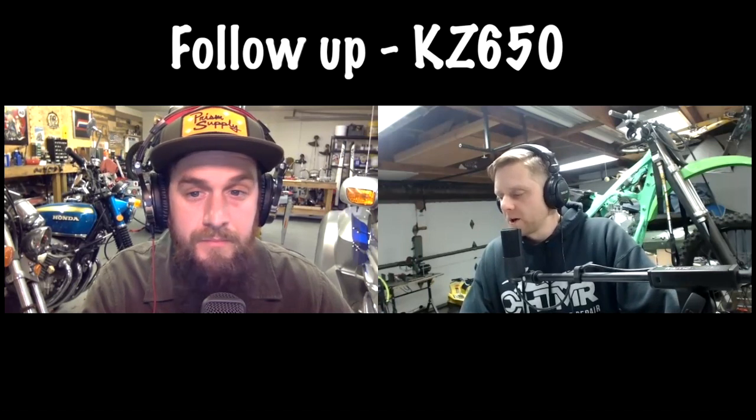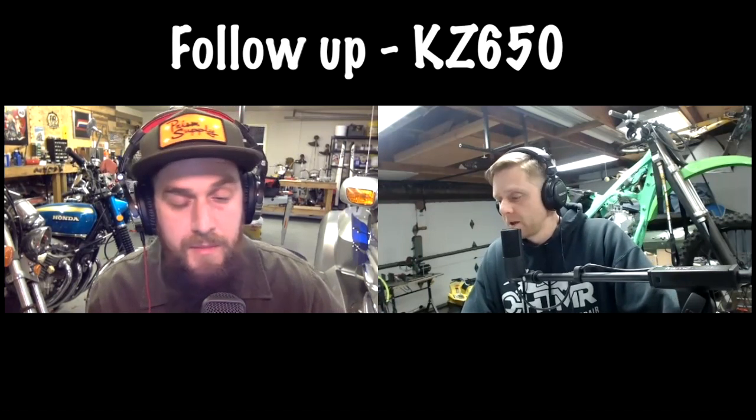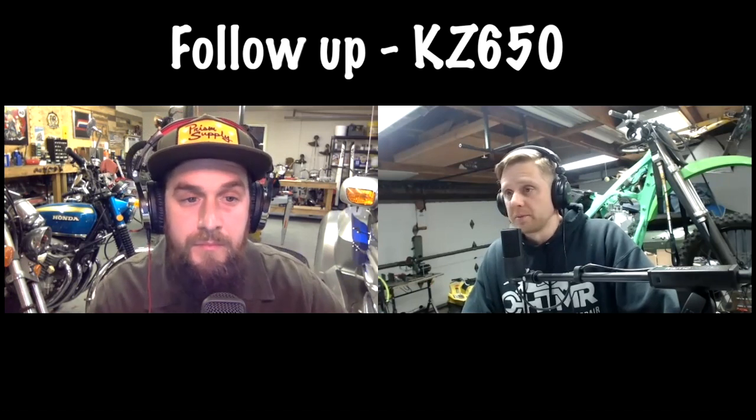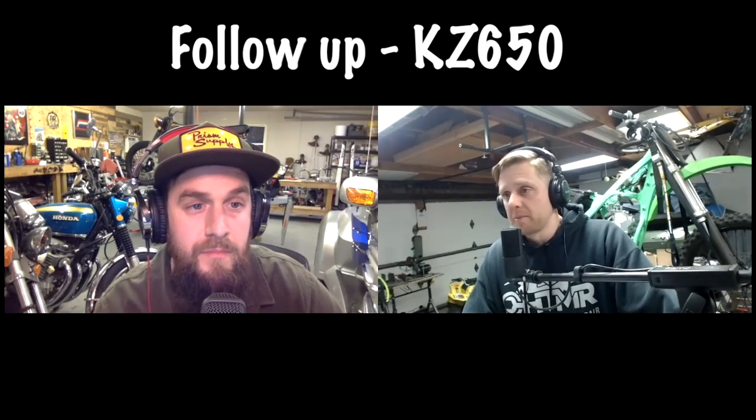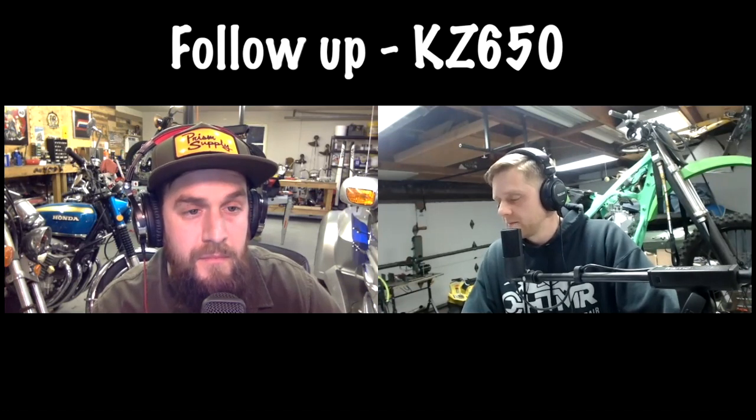Yeah, but the bigger question is the engine. I mean, okay, the pistons look good. Clean them up. I've soda blasted pistons, and they come out beautiful. Or dip them in chem dip. It'll burn all that carbon right off. Make sure all the ring grooves are really clean.